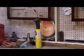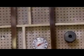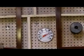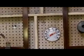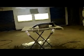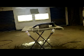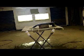About that temp, we're looking at just under 80 degrees, about 77, 76, somewhere along there on that wall. Now it's probably a little warmer over here. We're using 870 reducer, which might be a little slow or a little fast, but that's what we're going to use.